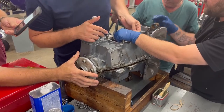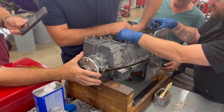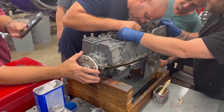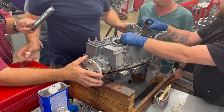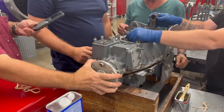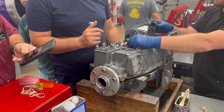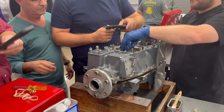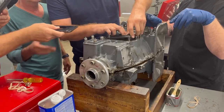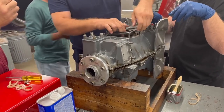Let's rotate the crank — rotate the crank — there you got it. If you have to, just pull it hard enough and snap it off. There we go. Okay, so now put your torque plates on where they are, here — just the top two for now. And that's mainly to protect the case from the rods.